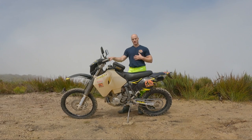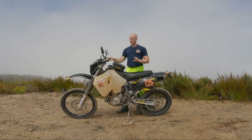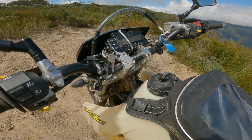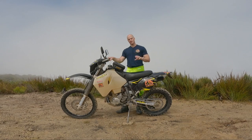Upgrade number two — and I am taller as well — is handlebars and a set of risers. One thing this bike comes with out of the showroom is atrocious quality handlebars. They're pretty cheap and nasty, and I wouldn't want to be in the middle of nowhere, drop my bike, and have the handlebars snap off. For peace of mind and for when I'm standing up, a nice set of high-rise fat bars with about one-inch risers gets you around two to two and a half inches higher than standard — just enough so you don't have to reroute any accelerator or clutch cables.